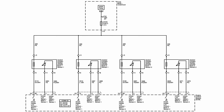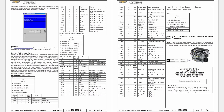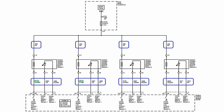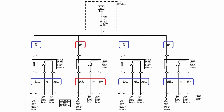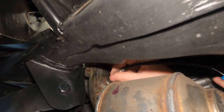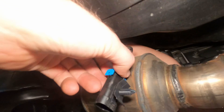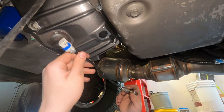This schematic page shows the oxygen sensor wiring. The wires running from the ECM to each sensor are the ones we shortened. Notice that each wire has a four-digit number you can use to find the circuit in the LS's official instructions. For example, wire 3113 can be found in the instructions, but wire 3212 is not in the English instructions — it is listed only in the French and Spanish instructions. All connections to two of the oxygen sensors are left out of the English instructions. Leave the oxygen sensor's wiring — the wiring between the sensor and its connector — alone. At least one of those wires is a different metal that is basically impossible to solder, something we learned the hard way. Also, if you ever replace the sensor, you don't want to have to modify the new sensor before you can use it.